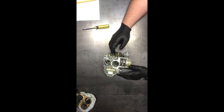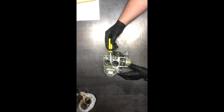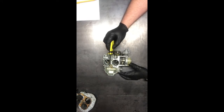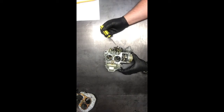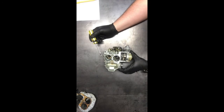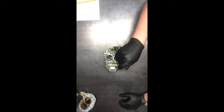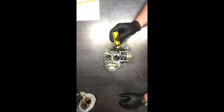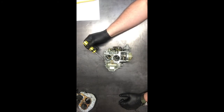Out of the box, the Weber is going to come pretty standard. The choke side is your primary, the other is your secondary. Up top you have your primary and secondary air jets. Your main jets are in the bowl and your idle jets are on the sides. Out of the box, your primary main is a 137, primary air is 165, and idle is 60. Your secondary main is 125, secondary air is 160, and secondary idle is 50.